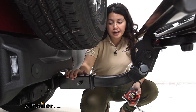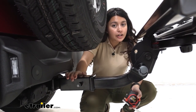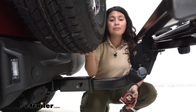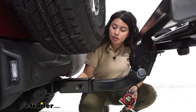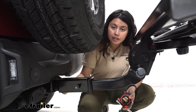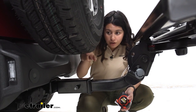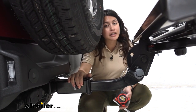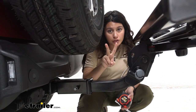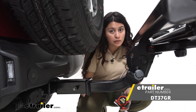With my experience with the Ford Bronco, when it first arrived I had a hard time figuring out what kind of bike racks and cargo carriers I could use because of its spare tire. If you're not sure where your hitch clearance is going to be, measure from the end of your hitch pin hole out, and then measure the height up to underneath the spare tire. Most bike racks and cargo carriers will not fit.